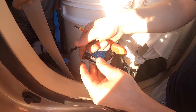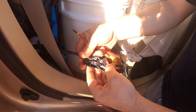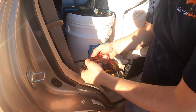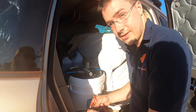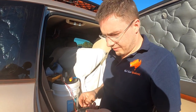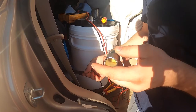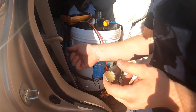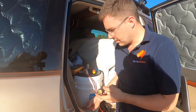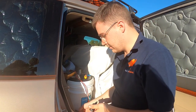Negative is always the outside, positive is always the pin, so they sit on there like that. You've got to know which one's positive or negative so you don't put your voltage the wrong way on the fridge — that is very bad. Cut this plug off; this end had 12 volt on it, so remember to unplug, disconnect, or remove your fuse and unplug both ends of your wiring before you cut through it, otherwise you'll blow fuses.